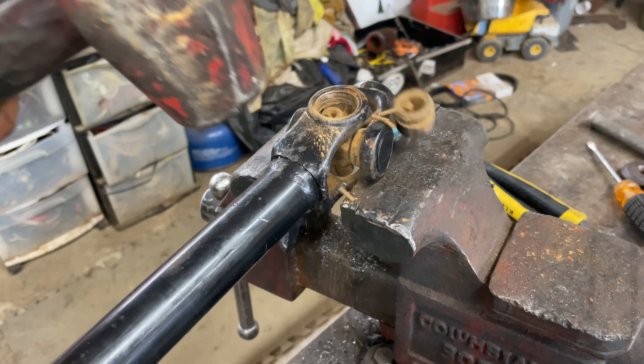As you can see, we've got this side over here that's tightened up. Now we're going to tighten up our other side. Once you get your lock set in place and it's up against the shoulder here on this yoke, then you can gently take your hammer and drop this cup down so we can get it to where we can get a lock on it. I don't know who made these little locks for these things, but they must love hurting people's fingers. We got it down and got it started — now we got this one together.